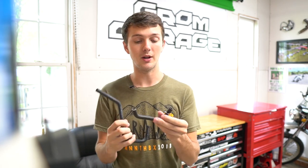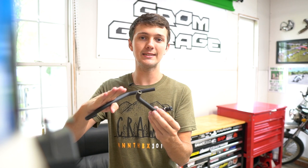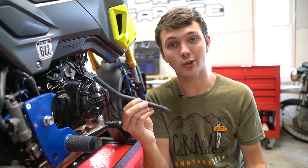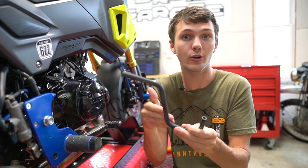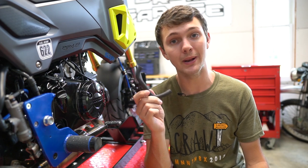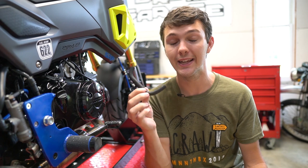But the problem with that was, while the oil is sputtering and trying to force its way up with that pressure, I gave it less distance to travel. So it was easier to get into the intake, and obviously, oil got into the intake. So I'm going from the shorter line to the longer line. You guys get it, it's a longer line and the oil is going to be harder to push up the longer line. But I can't stress this enough, this line probably would have been 100% fine if I just would have properly filled my oil. But because I overfilled it, it happened.